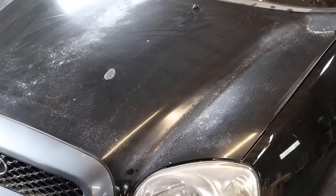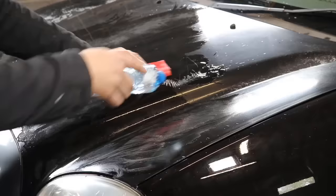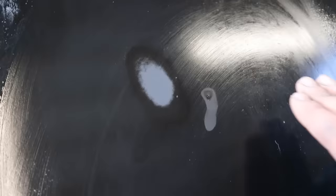I am starting out with 400 grit sandpaper. Probably later on I will move up to 600, but for now we will be using the 400 grit. In any areas where the paint is lifted off, I am just feathering the edge on the paint. This will give it a smooth transition so when you paint over, it leaves no dips or hollows in the paint.